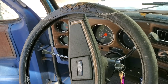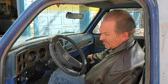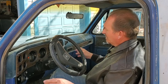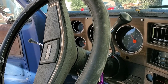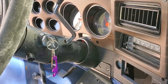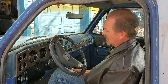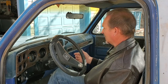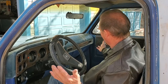We've repainted the needles on the dials, but not everything's working. We know our fuel gauge isn't working properly, so we've got to work on that. We already told you we've got to work on our twin tank system — the switch for that is over here. There's a lot of things to do here, but so far we've mostly been doing things to get the systems working, with a little bit of cosmetics since we had to take it apart anyway. One of the big problems up next is the signal lights do work but they don't cancel. So we're going to be rebuilding the inside of the steering column and getting rid of this steering wheel — the correct ones are in the realm of $200 used, so we're going to put on a modern steering wheel and make it look a little nicer. Everything's worn but solid. There doesn't seem to be any rust-through anywhere.